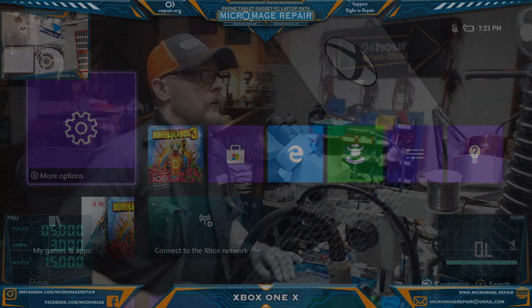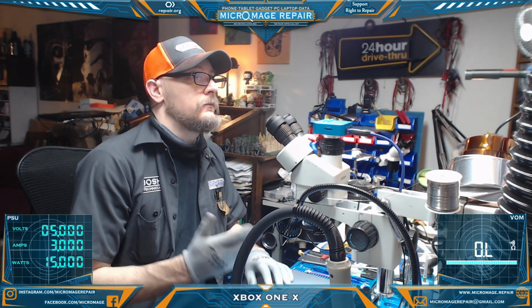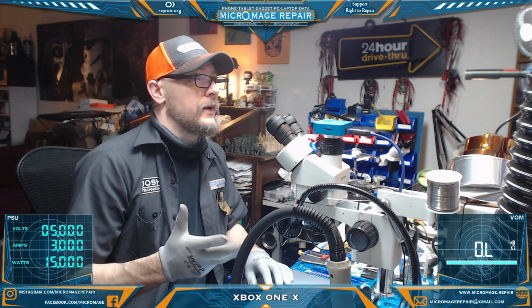Alright, everything looks good. Okay, in summary, we had the issue with this Xbox One X was no video. We took it apart, we tested the drive, tested out fine. We did diagnostics on the board. Everything seemed to be pointing to the retimer. We replaced the retimer. Everything seems to be testing out fine, and we're good to go.